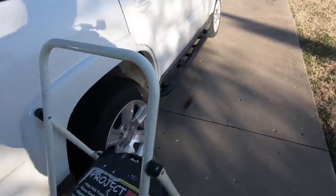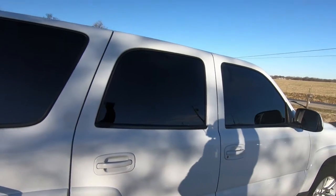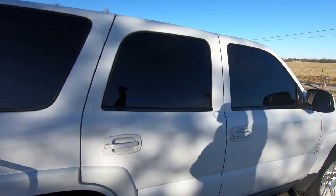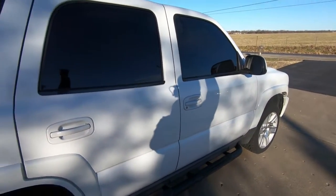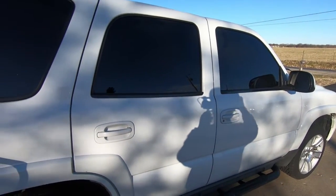Now, I've done this a couple different ways. In the past, I've used the little Christmas tree push pins, similar to what your inner fender goes with. On my black Tahoe, and I'll list both those videos down below in the description, guys, that's what I did. I just used plastic push-in pins, put a little silicone on them, and pushed them down in, and never had any leaks or any issues.